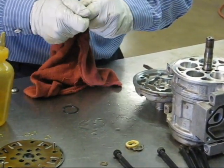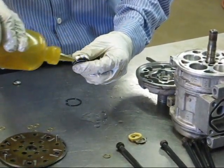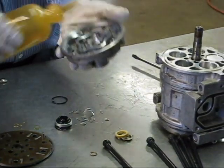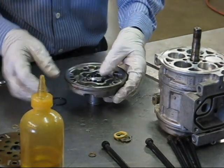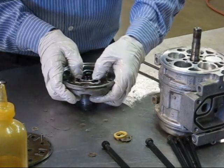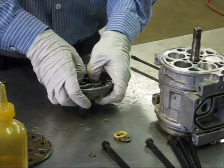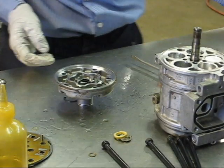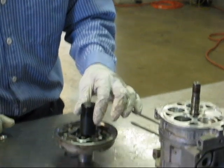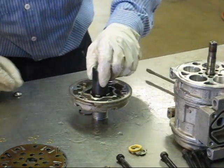That pre-expands the seal and makes assembly much easier. The next step is we lubricate the outer O-ring of the seal that seals it into the head plate, adding oil to both surfaces so that everything will slide together. Then very gently get the seal started into the housing without pinching the O-ring. Push it down as far as you can by hand. At that point use a plastic pusher tool or a socket — anything that fits around the outer edge of that seal — to push it down squarely and seat it in the cylinder head itself.